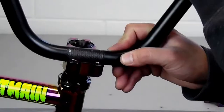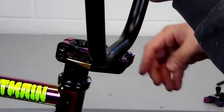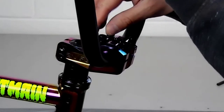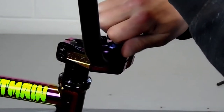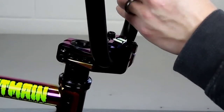There's a knurl on the bars, and you want to center that in the center of the stem. One thing I learned is that you always want to put the cap on the same way it came off. Some of them look very symmetrical, so a trick I always do is take my right back bolt out — that way I know exactly how it goes back in. I always try to get them all started a little bit so I know they're all threading in correctly before I tighten any of them too far.